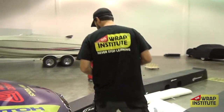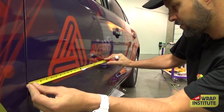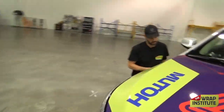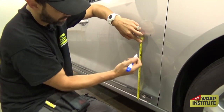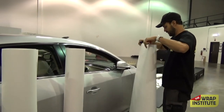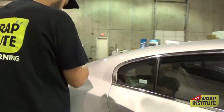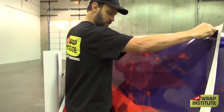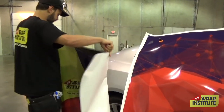The overall story for the passenger side — let's get to it. First thing you want to do when setting up the passenger side: use the completed driver side as your template to quickly get measurements and make sure both sides are the same. In this case, the bottom of the text on the door is about eleven and a half inches, and the side of one logo is about four inches from the front door. I mark the bottom so that as I lay panels out I have a quick read for placement. It's just professional, especially for fleet work.